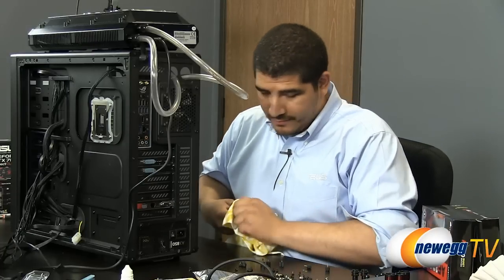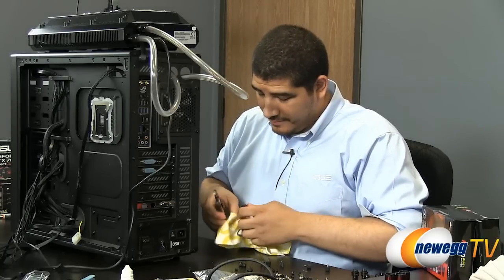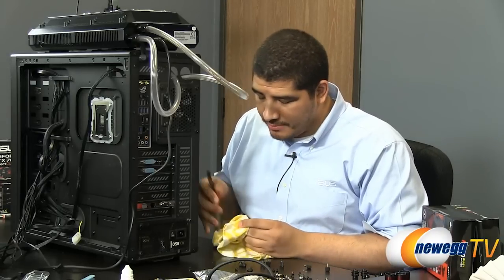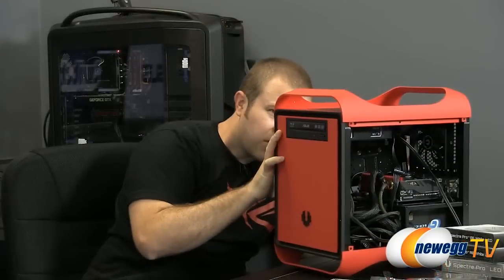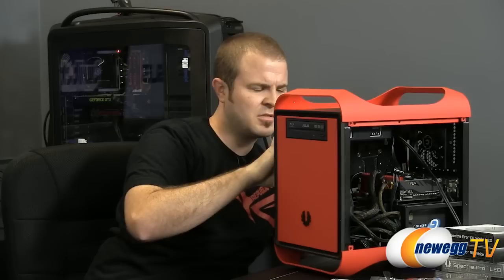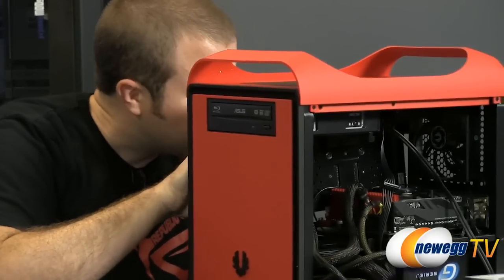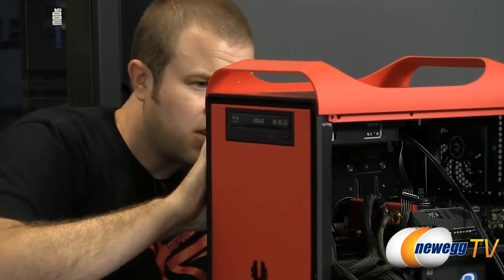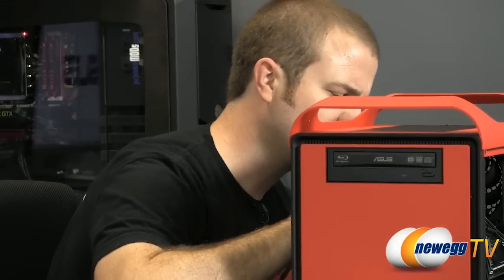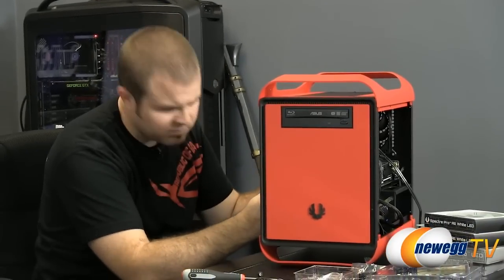I think you've said the answer to this question several times already, but it's a different question with the same answer. When will we see right angle 24 pin on more motherboards? From us, we're probably not going to do that anytime soon. The main reason is that we've done a lot of internal testing, and we feel that the overall rigidity and signal integrity from the power layout is a bit of a concern. So unless we could feel supremely confident in the quality of it and the design implementation, it's probably not something that we'll do. But we do look at that occasionally, every 6 months or so, and see if there's maybe a different option or something that makes sense. But as of right now, we don't have any projected plans to do that on our motherboards.